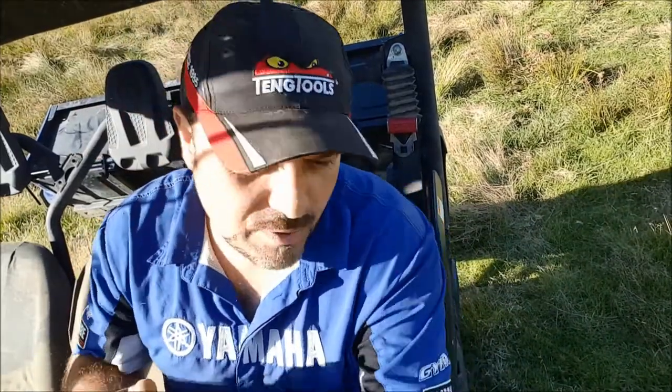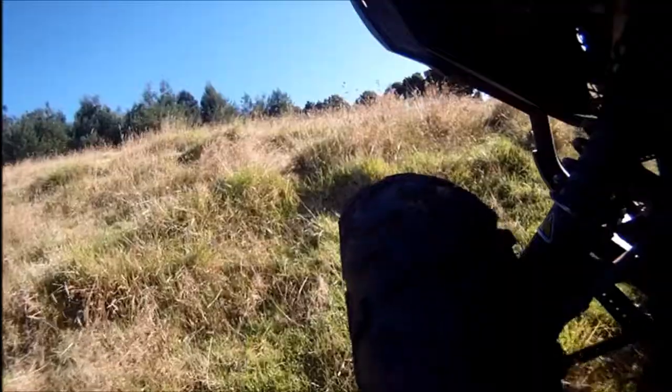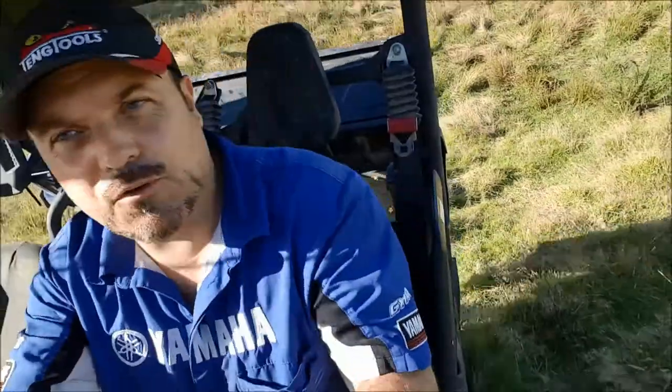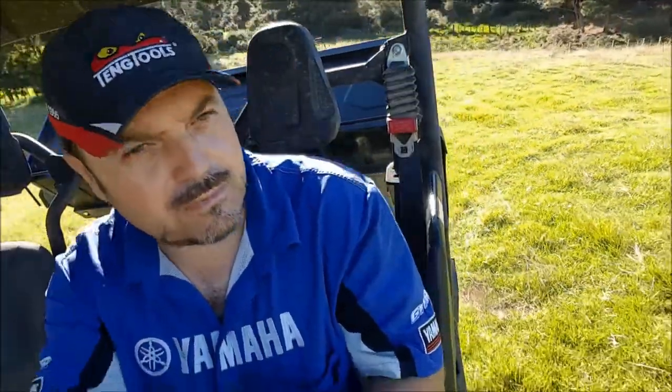Vehicle wouldn't go up the hill. Now, if we engage four-wheel drive, that should engage the front wheel drive, and we should be able to go forwards. So the front wheels now are being driven. We've got four-wheel drive. So let's check the four-wheel drive system for us, just making sure that the solenoid on the front diff is working correctly.